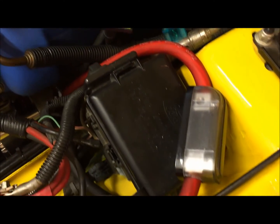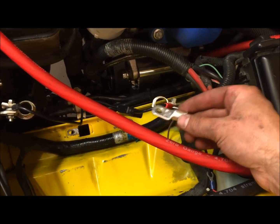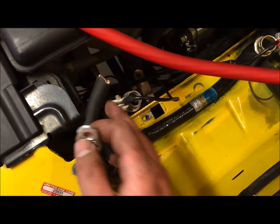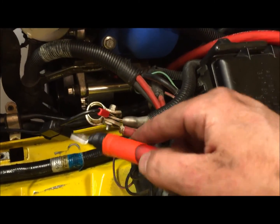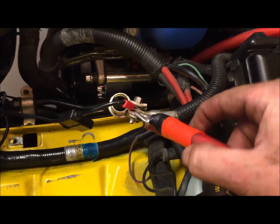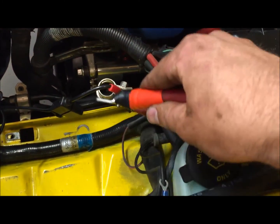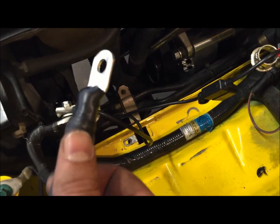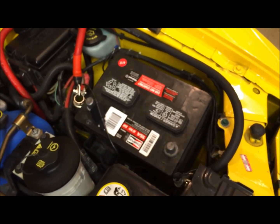With our line coming up from the alternator with the inline fuse, all we'll do is add the attachment fittings here to go back onto the positive side and add one back onto the negative side to go onto the negative terminal. We have our power wire coming from the alternator and we'll attach it in here. We'll connect the negative battery terminal to its connector as well — we just crimped those ends as we have been doing. Then from here, just connect your negative and positive terminals.